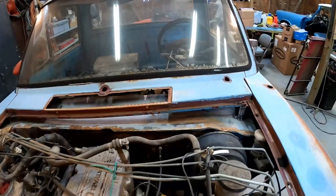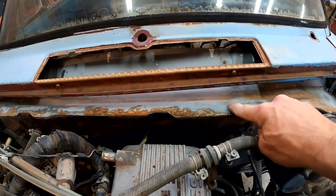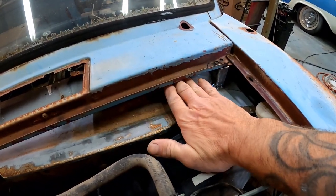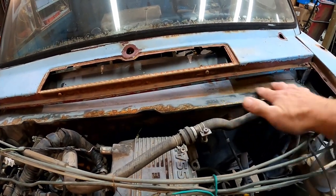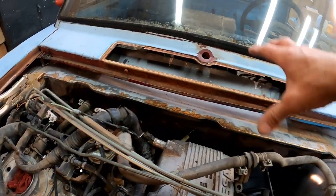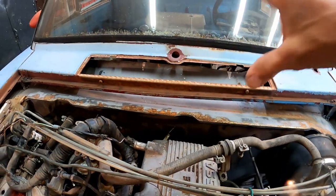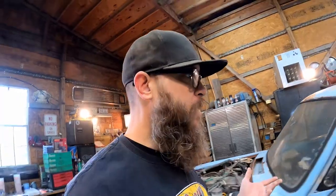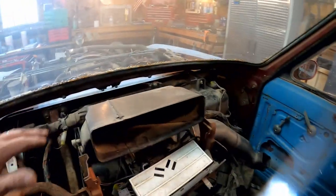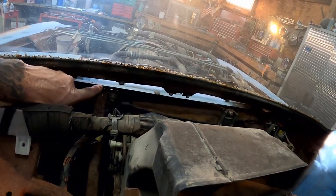I did a little bit of work off camera — I've actually got the old cab fastened to the 1995 Nissan cab. Here's the old cab, here's the '95 Nissan firewall, what's left of it. What I did is I raised this back up just enough to get clearance so none of this was interfering anymore. We've got kind of an oddly shaped top going on with this firewall, all kinds of layers in there. There's no way to trim it further without sacrificing all of our heat and air ductwork, and all of that stuff is the whole reason I wanted to do this — I need all that to stay. So we got it up just high enough where there's no interference.